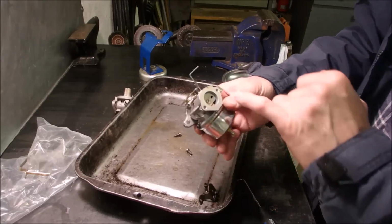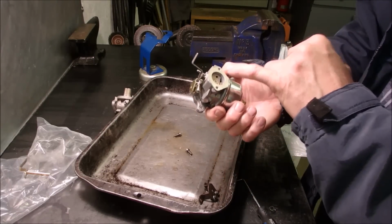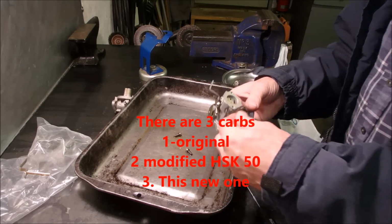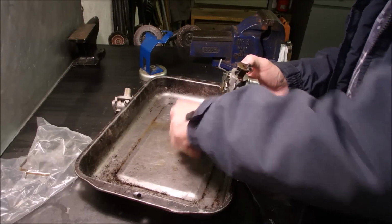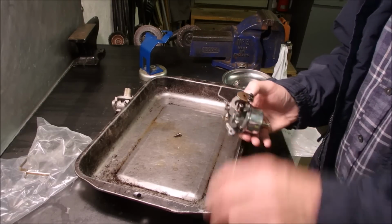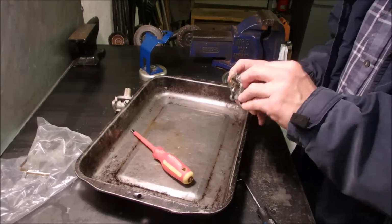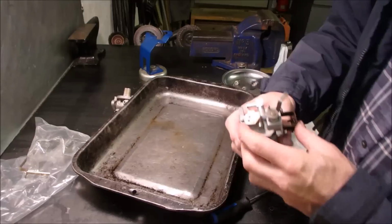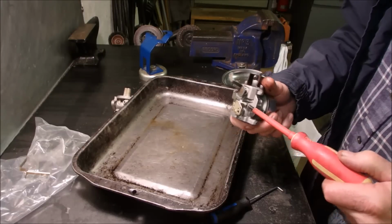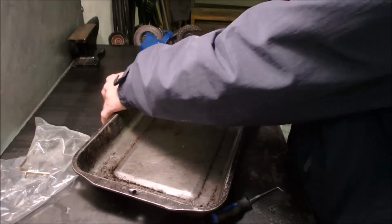Okay, tubes, we've got the original choke lever from carb 1 onto the body of the new carburetor, and we're just going to get ready to install it. I need to have the intake housing bracket on here. We've got a throttle. I might just turn that idle up a tiny bit. There we go. And I think that's ready to install.